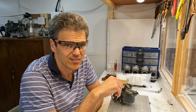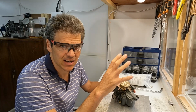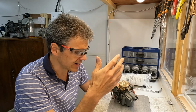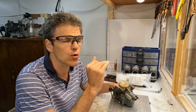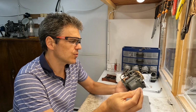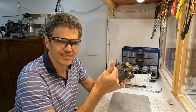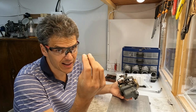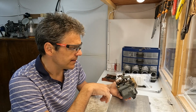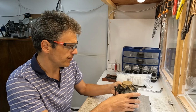And B, something that I've said 100,000 times probably on the channel, but I'll say for the 100,001st time: whenever you have a classic car that's been sitting for a long time, or you've restored it, or you're putting it to use for the first time in a long time, you always 100% must clean all the fuel lines, clean the tank, clean everything, because if not, you're running the risk of what happened in this particular project, which was that ingress of dirt and rust into the fuel bowl, which may or may not have damaged the needle and seat assembly, to be fair. I don't know for sure, but I think now this unit is in much better shape to be installed back into the car and start running, basically.